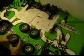Just like that. Take the inner ring, line her up, and what I'll do here is I'll get two of these started, one on each side, and I'm going to actually run them down until they're pushing on the rubber, because that'll actually start to hold my bead in. Go like that, and we'll grab this one. Run that down a ways, and what that'll actually do now is stop the bead from coming out. Just like so. The bead's actually set in. Now I can go back in, put all my other screws in, do the star pattern tighten up job, and this wheel is done, and I'll do the other three.